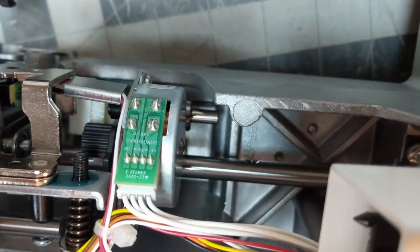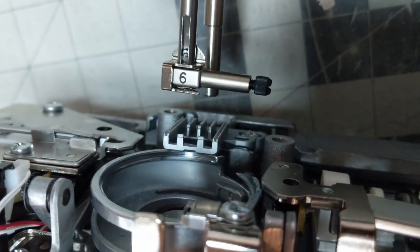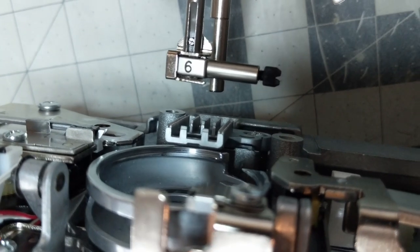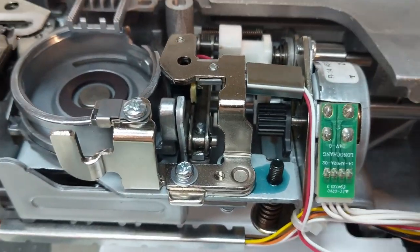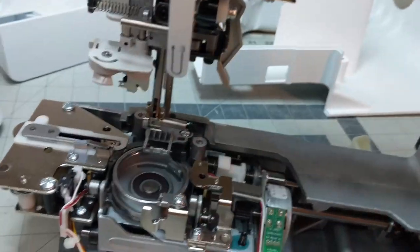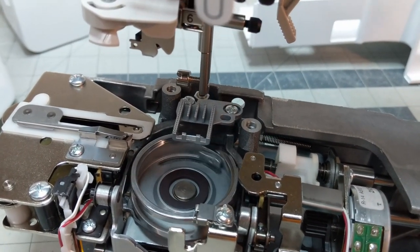These little stepper motors are really handy. When they start putting these in the machines it's actually a good thing because they're very precise. When you change things like your feed rate, the feed dogs right there are controlled by a stepper motor and it's very precise on the stitch length. So these machines have a very consistent stitch because the length is controlled by the electronic brain. This one over here is actually probably your thread-cutter motor, and this motor right here is going to be controlling your feed dogs. See how they'll go up and down, but they're not actually going back and forth — because that's controlled by that motor.